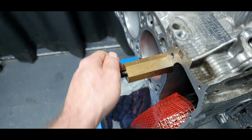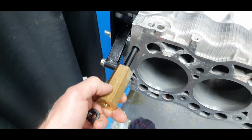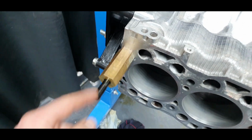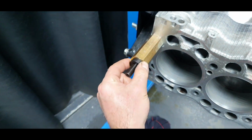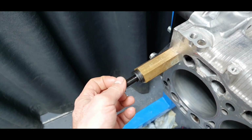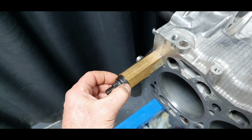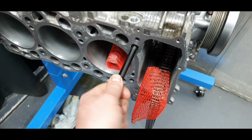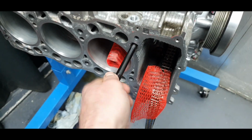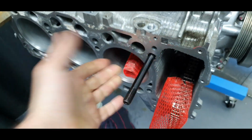Now, let me put this also on the video, so there isn't any misunderstanding. The cylinder head at this point, on the last stud, is not 72.2 millimeters, it's 81.2 millimeters. That means if I get these three washers that are 3 millimeters each and put them in, I'm getting 0.05 millimeter. I chose this position because I cannot bolt the stud in more by hand. Now it's stuck, okay? That's how much I can bolt it in.